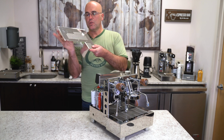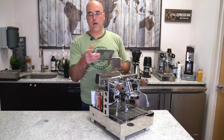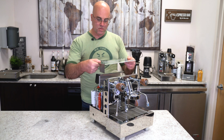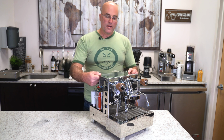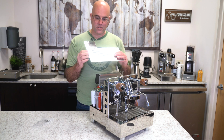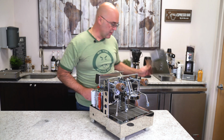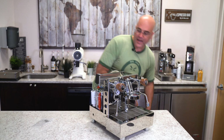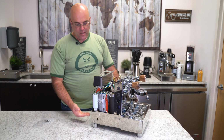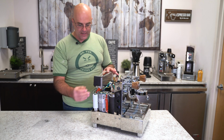This part is basically your tray, and there's a little rubber mount here to help with vibrations. When this is laid in the front, whoop, goes right here. Now here, there's ports basically for venting to preheat the cups, but also here is a venting port for the brain unit. And that is important because the brain unit is near the top of the machine, and the heat is all pretty much up here, which is nice. So the brain unit's further back.